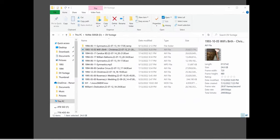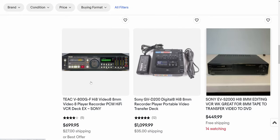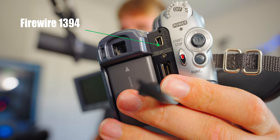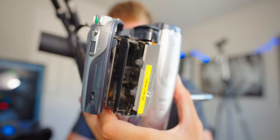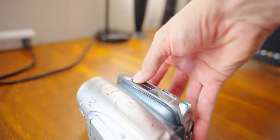The last thing you're going to need is the footage on the tapes. You need a way to read the footage on the tape. You can either buy a professional tape deck — these run for about a grand on eBay — or you can buy a camcorder. These are much cheaper, but you need to buy a model with a Firewire port. Firewire is the easiest, highest quality, fastest, and cheapest way to read the footage on your tape. We need to figure out what kind of tape you have. My mom had Hi8 tapes, which is a Sony format. You probably have MiniDV, which is a more universal format, widely adopted, cheaper, higher quality video, smaller tapes — better in every way than Sony's Hi8.